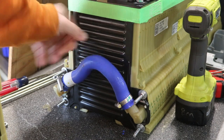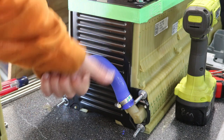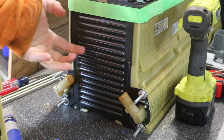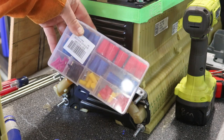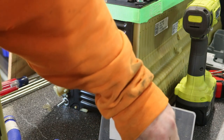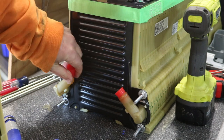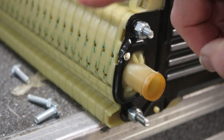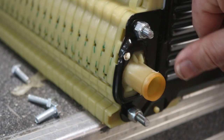All I was using this for was some quick pressure testing — blow in one end and feel air coming out the other, or put my thumb over it and feel that it was sealed up pretty good. But for proper coolant flow, we actually need the flow going through the battery. I've got a kit of silicone corks here, like for painting or powder coating, where you can stick it in a hole and keep your threads from getting painted. The large size looks like a pretty good fit. I'm going to put these in to close this up, and then I can get a sense of airflow through the battery pack from the one end. Since the other end is now corked up, fluid should move sideways through the pack.